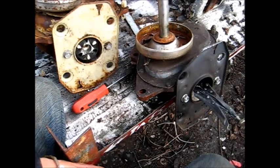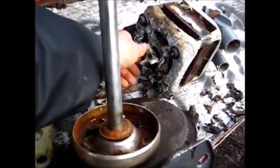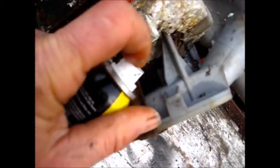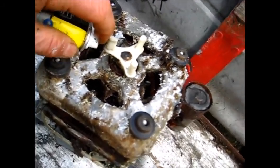If you have a motor that's been sitting for a long time like this one and you find that it's frozen and won't turn, what you can do is take a little bit of oil or WD-40 and spray it up in here, a little bit here, a little bit there, maybe a little bit down in there, back in here, and back in here. If you look inside you'll see where the armature gets very close to the windings, and you can spray a little in there just enough to moisten it up.